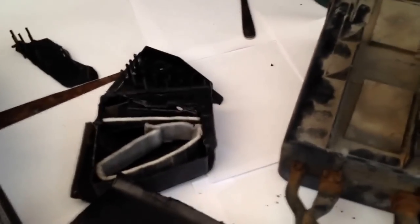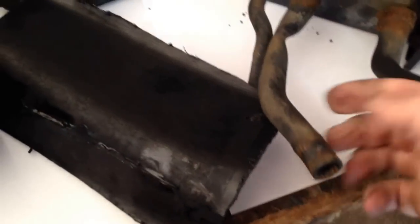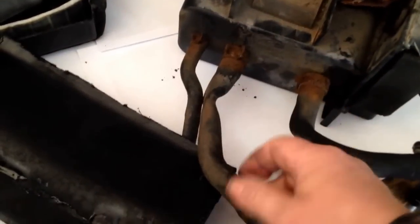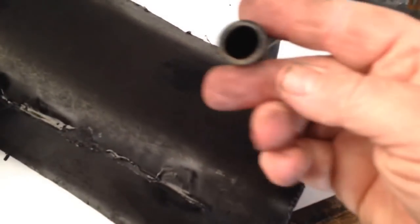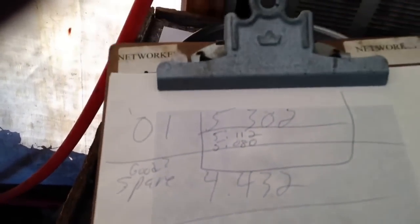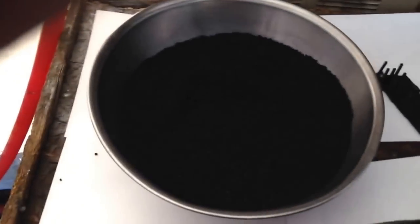When you smell the outlet tube right here — air is blowing through all the charcoal pellets and back out here — I could actually smell fuel coming out of that hose, and I still do. So I'm going to keep blowing through there until it stops dropping in weight. It's pretty significant that it went from 5.302 down. I've got pellets all over the place — I don't know if you can reuse these pellets again, but I'm certainly going to try.